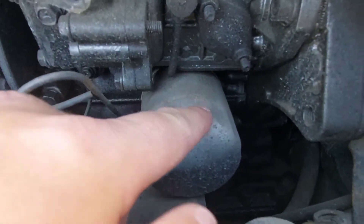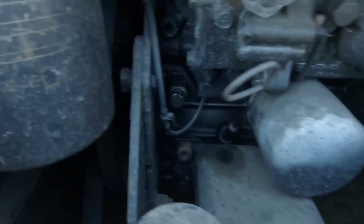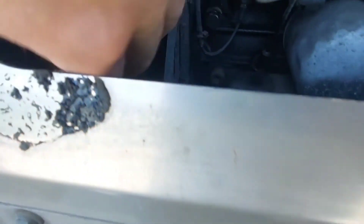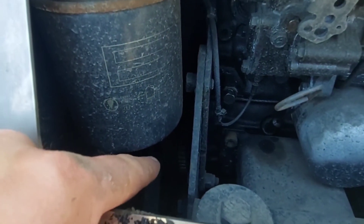Here's your oil filter. You just want to inspect it and make sure there's no seepage of oil around. And way down here, behind the fuel filter, is your belt. You just want to pull on your belt and make sure there's a little bit of tension and it doesn't look all worn. It's hard to see, but it's back in here.